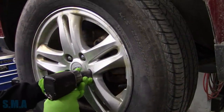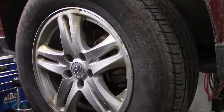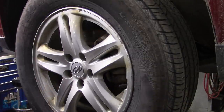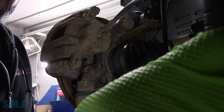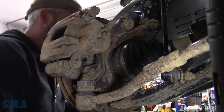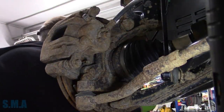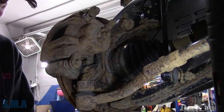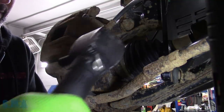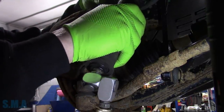I think it really doesn't matter where we start, so we'll start at the left front. We'll get the wheels peeled off. We're going to do one wheel at a time. Get a little light in here so everybody can see. I'm going to peel our brake calipers off. Looks like 14 first try. So far, so good. Typically I do both sides simultaneously - I usually do one first then the other if I'm doing a video, so I've got all my appropriate tools out.